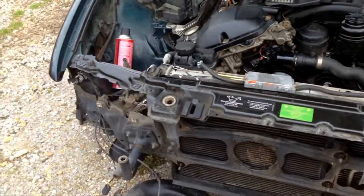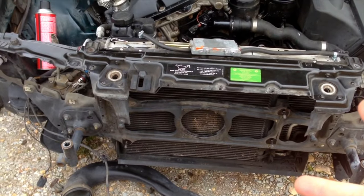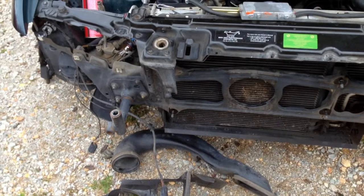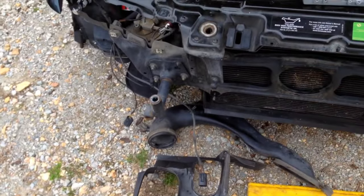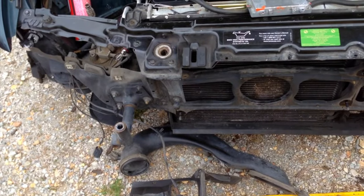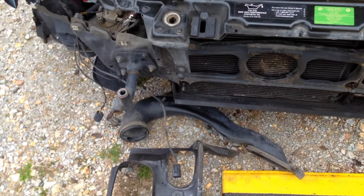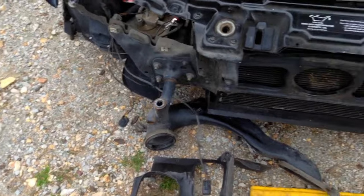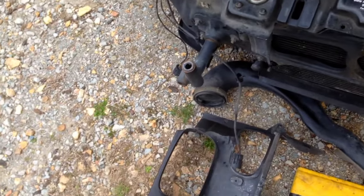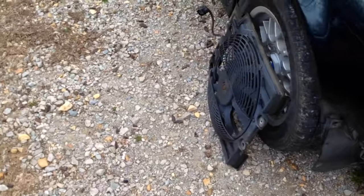It's currently two days later. The owner just left here — he went to the junkyard and got two electric fans, and they are both bad. You might say it's gotta be something with the car, but it's actually not, because we turned the AC on and we got 14 volts going to the plug. The two fans he had — we bypassed the resistor pack on one just to see, and it fired right up. So both fans had a bad resistor pack. The AutoZone fan also had a bad component on it, so he's returning that.